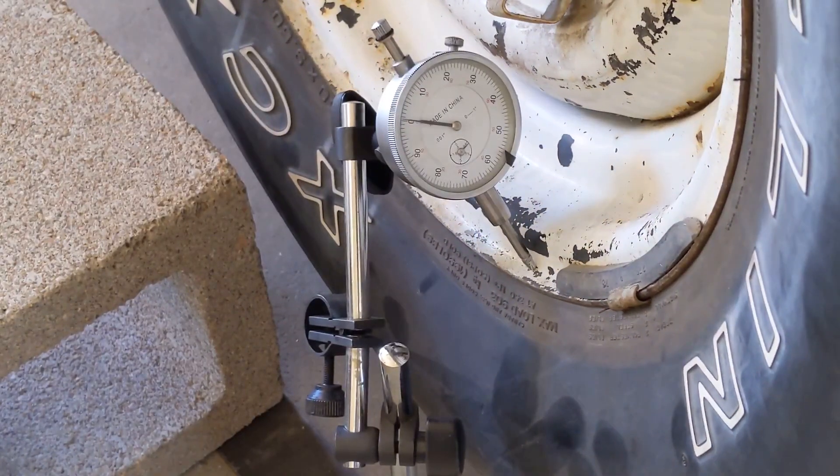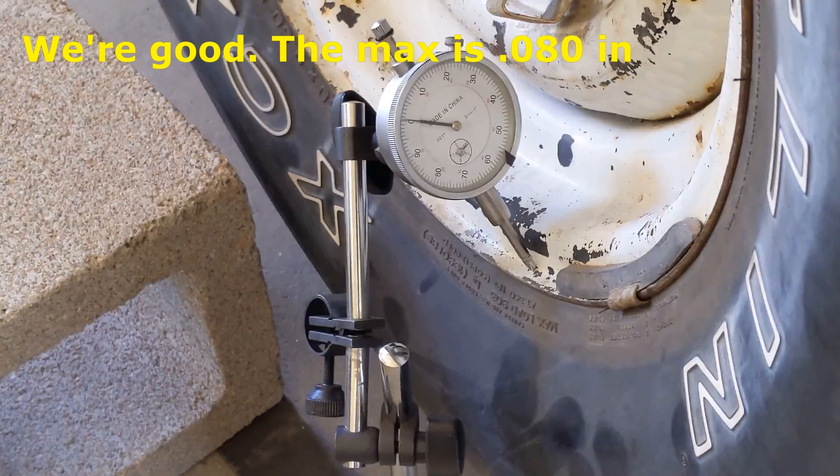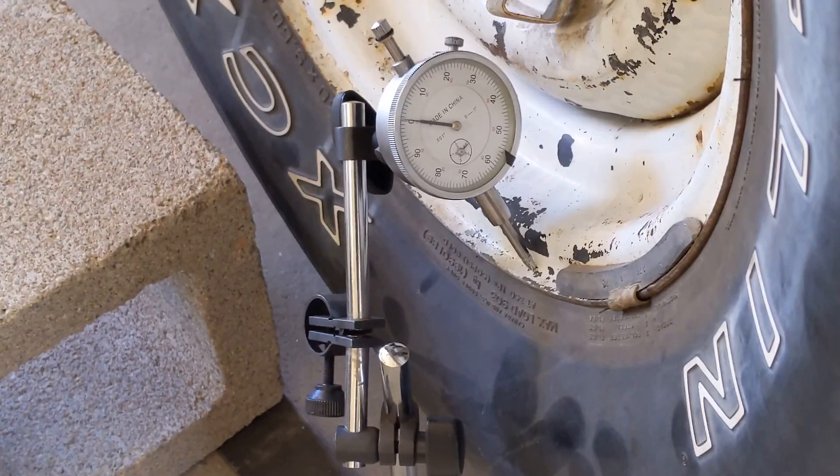It's like we got about 0.060. That's a little larger than I'd want to see, but it's really not a bad number. I've gone and measured all of them — I did the same thing on all four wheels and got roughly the same numbers, about between 0.040 and 0.060 on everything, which I think is probably good enough. This isn't a high-speed vehicle, it doesn't go fast. And these wheels are pretty close to acceptable, so I'm going to go ahead and use them. I thought I'd document it because it's been a problem for me in the past.